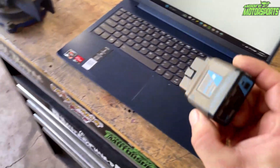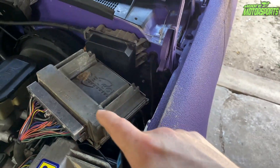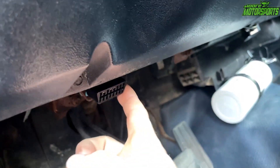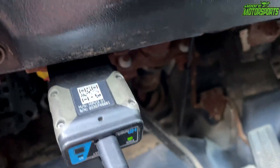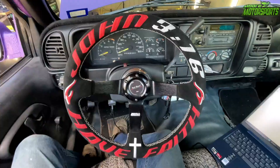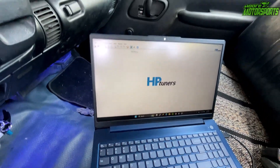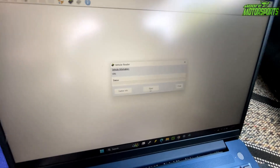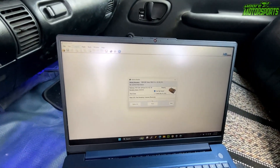I'm going to get this plugged in. We're going to be using my truck — I have the wire harness connected on the blue plug. I have the Jackspan Racing standalone wiring harness OBD2 plug ran to the inside, so we're just going to plug this in. You'll see the light is on, we've got the cord connected. I'm going to plug it into the laptop, turn the key to the on position, go over to Read Vehicle, click that, click Read. This usually takes about two minutes roughly to read the entire thing.